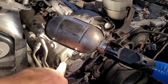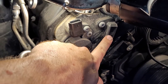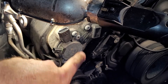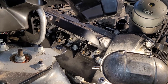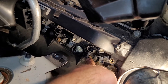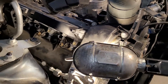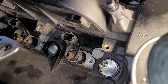The wiring harness is off and everything is disconnected. By the way, the bank 1 camshaft sensors — here's one right here and here's another right here. These were the two giving me codes about a correlation issue between the position of the camshafts and the crankshaft. I took the wiring harness off, ignition coils off, and the fuel rail off. Now you can see the top of the injectors. This is a direct injected engine — old fuel injected cars had injectors right by the intake, but this uses over 2,000 PSI fuel pressure with high pressure fuel pumps. It gives you a little bit more stratified fuel spray, better gas mileage, and a little bit more power.